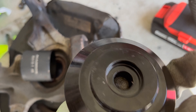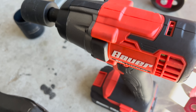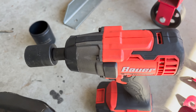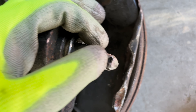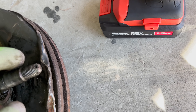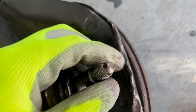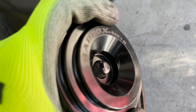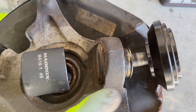I said forget it — I'm using the actual ball joint remover. I have the adapter here — you can't use just any side. I have the receiving cup and the impact with a 22 millimeter socket, which is the size of the end of the jack screw. The only problem is that the brake dust shield is in my way of putting the end of the ball joint straight so I can push it out straight. If I have it straight, the adapter doesn't fit — I have to tilt it almost all the way up to get any access. If I can get it to move a little, I think I should have success hammering it out with the actual hammer.